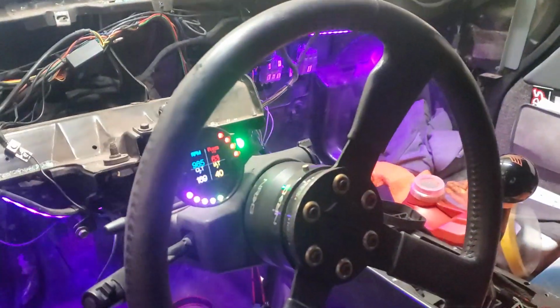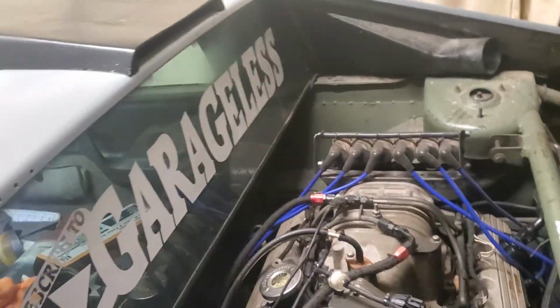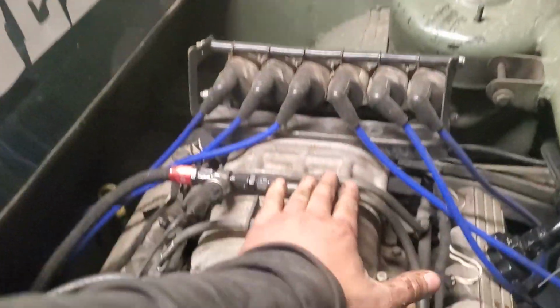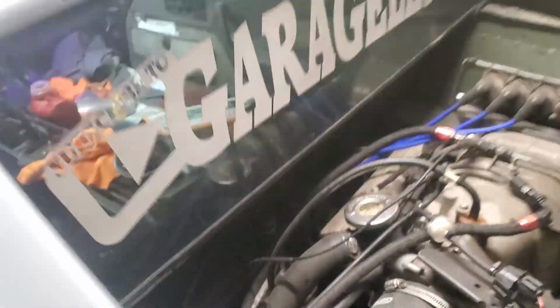Yeah, just brought it up to temp, and the fan kicked on, so that's good. I'm gonna let it do it one more time to confirm that it's not overheating. So no leaks right now. She's running good. So I think hopefully we can fix this stupid tick. It's just the fuel pressure, right? But so yeah, if we look at this, I don't know if you can see that, but it's basically at 40 psi. So I set it to 40 psi.